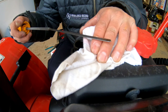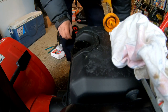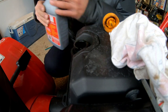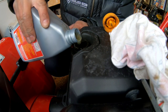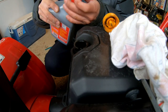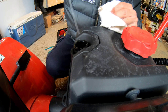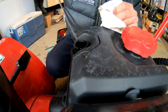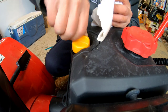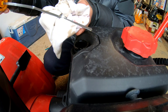You may need a little bit more to get it to that dot. But honestly, you do not need to give this one an oil change. Either way, I am going to show you how it's done. We're going to add a little bit of this 5W30 synthetic — it's okay to mix this with regular oil. I'm just going to top it off just a little bit because it is a little low. Don't want to overdo it, just a little to top it off. I'm going to check the levels now. Wait for it to settle for about a minute or so, because when you pour it in it's coating the side of the reservoir and goes all the way down. Oil is pretty thick, so you want to wait until it gets all the way to the bottom. Let's wipe it again — perfect, right on the nose.